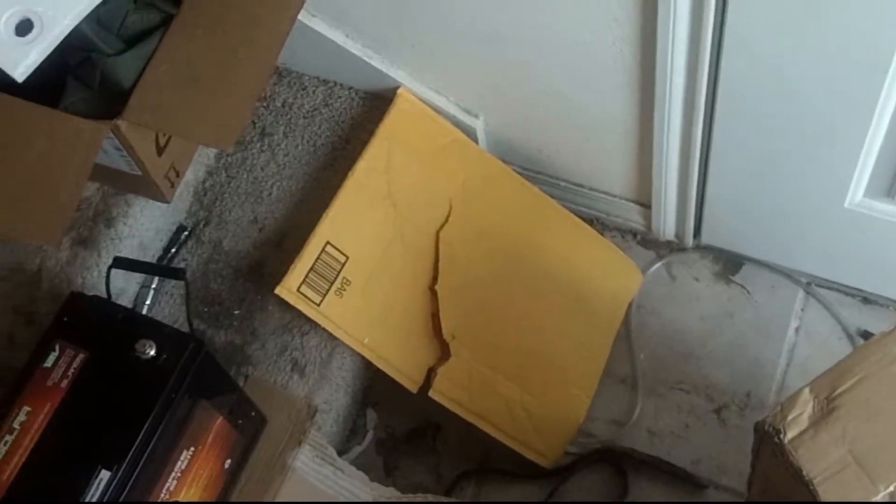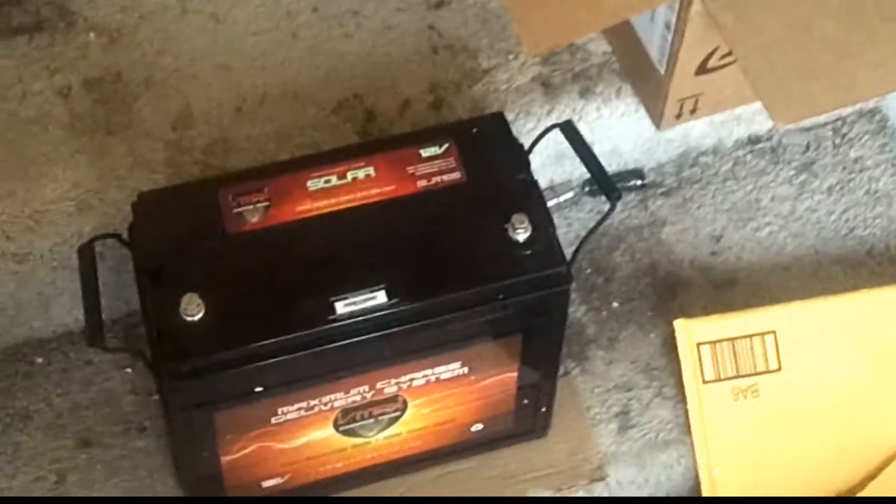A lot of people expressed interest in it — 155 amp-hours. I have another one over here under this smaller box, exactly like this. My job is going to be either having a battery box constructed or constructing one myself that's beefy enough to prevent these things from turning into head-breaking, back-breaking missiles in case of an accident.